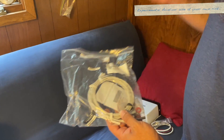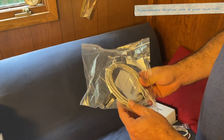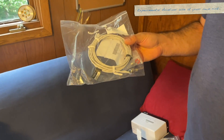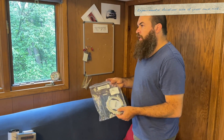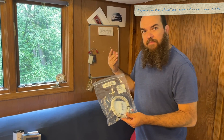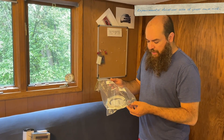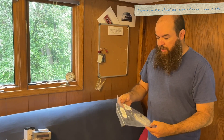This is the outside air temperature probe. It connects to the GSU-25. We don't have the GSU-25 here yet, but this just goes outside. In the RV-9 we installed it under one of the wings, near one of the access plates. The rule of thumb I've heard is you don't want it inside the prop slipstream because the accelerated air will distort your temperature, which changes your true airspeed. Putting it out on the wing, even just a few feet off the center slipstream, really helps.